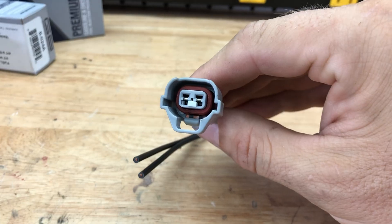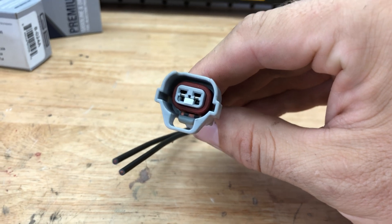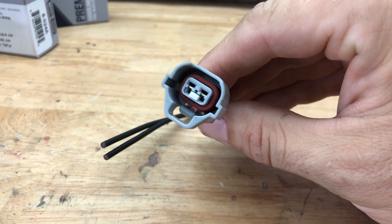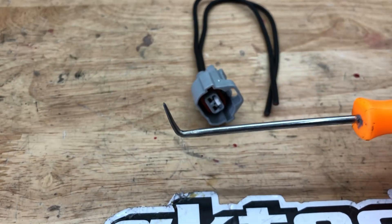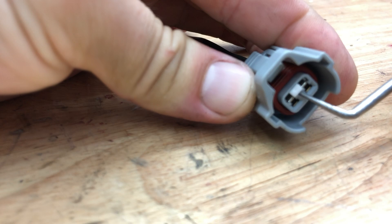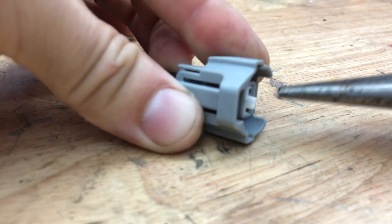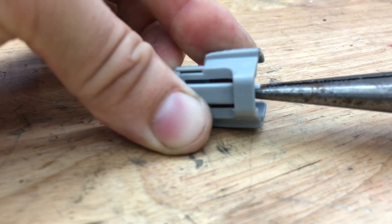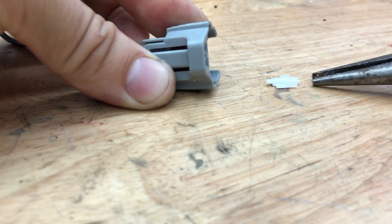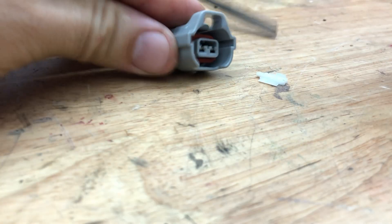We're just going to reinstall this clip. If you look at this clip right here, that little white square - this little white square on this connector is the locking clip that holds our pins in place, or part of the locking clip. So we have to get that disconnected first. Using this pick right here and some needle nose pliers, there's a little divot right here where we can just slide in there. See how it slides that out? That's our little locking clip right there.